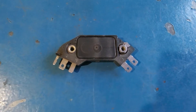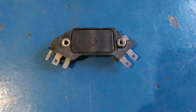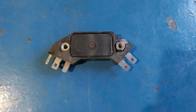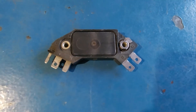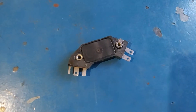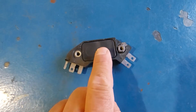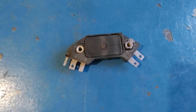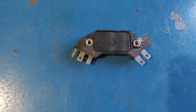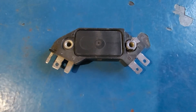I'm going to start talking about this one. This one was made for two years only, in 1980 and 1981, and came equipped in GM vehicles that had the Oldsmobile engine. This module was originally intended to control emissions as they started getting stricter starting in 1980. If you do not connect this R pin to anything, it's going to operate exactly like a four-pin module. However, if you connect this pin to ground, it's going to delay timing five degrees. Originally this pin was connected to a vacuum switch, and during high vacuum that switch would ground this pin and delay timing five degrees to control NOx emissions.